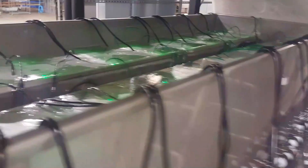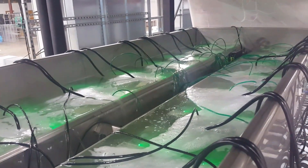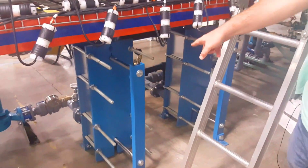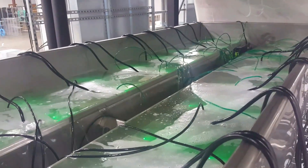We actually take the fans off of our M20s and put them under a thing called dielectric fluid, which is non-conductive. There are 32 M20s running inside of this vat, and it's being cooled only with water on the outside. The water mixes with a heat exchanger down here, and the heat exchanger cools the dielectric fluid.